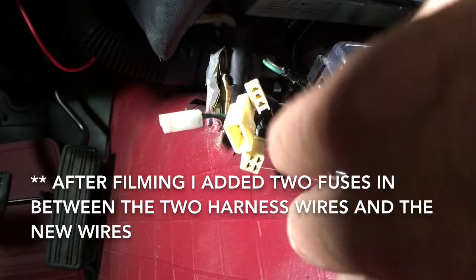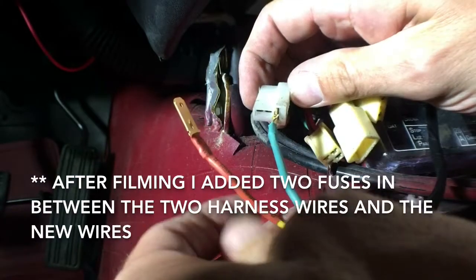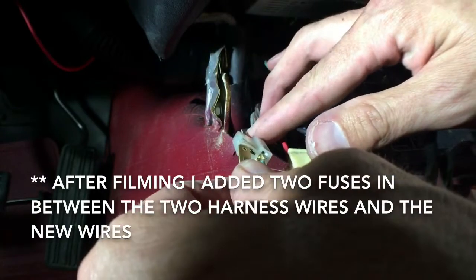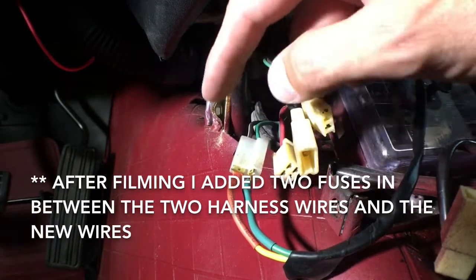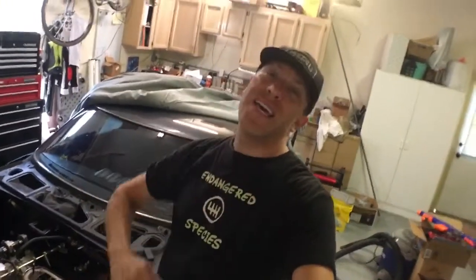All that's left now is to plug the green wire that we did to the fuel pump, and then our yellow wire that goes to our ignition, which is a black with white stripe on the car side. I'm going to order the actual harness to go over this, and put some electrical tape to cover it up and protect these connections — I'll come back and redo this terminal at another time. We finished up the fuel system in the 1973 Datsun 240Z. We've got a few more things to button up on the engine — we're going to be doing a power line all the way to the back of the car and building a battery box. Stay tuned, and thanks so much for watching — if you like what you see, don't forget to subscribe, share it out, and have a good one.